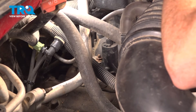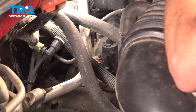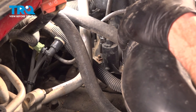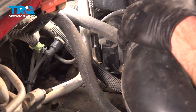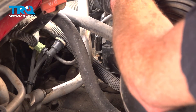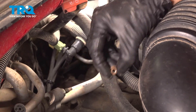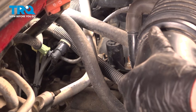Now we can move along to the mounting hardware that holds this down. Looking along the backside, you're going to find a 10-millimeter nut that holds a bracket down to the top of the mounting hardware that holds the solenoid down. Let's remove that nut first, remove the bracket, and then continue on with the hardware for the solenoid itself. With that mounting nut removed, take hold of the bracket, lift it up and off of there. Then we'll be continuing on with our 10-millimeter.